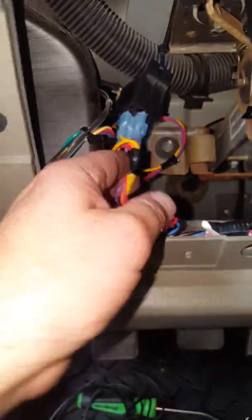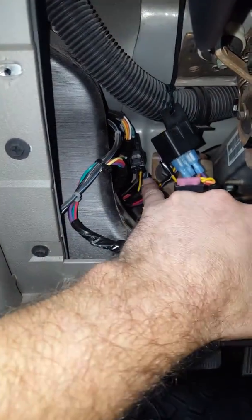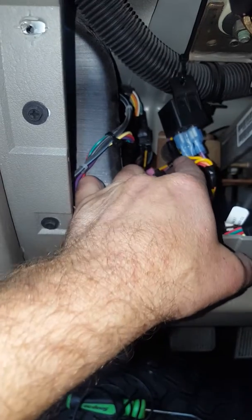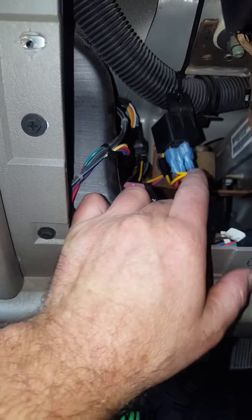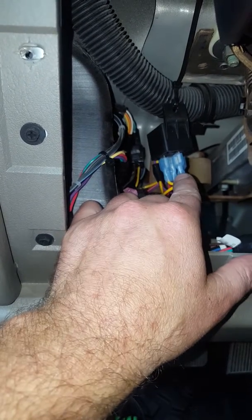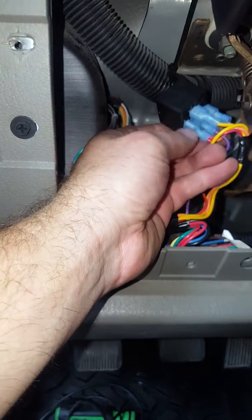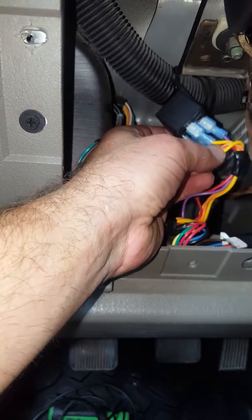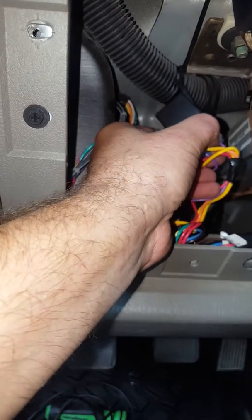Since it's a 6-speed manual, I added this relay, the yellow with orange stripe down here. I attached my single yellow wire over here because it goes to ground on the clutch. The other side's an ignition, so I have the cruise's brake wire together all the time, so anytime they hit the brake, it connects those two, or they stay connected, and it makes the cruise disengage. And then on the other side, I ran from the hot side, so when the clutch is pressed, it doesn't feed back to the brake lights, but it feeds from the clutch, from this power to the brake kill switch.